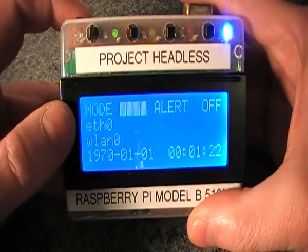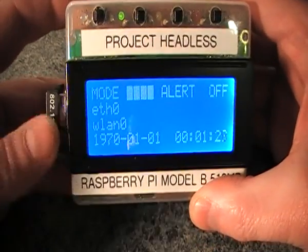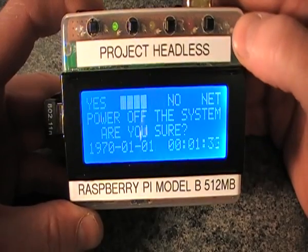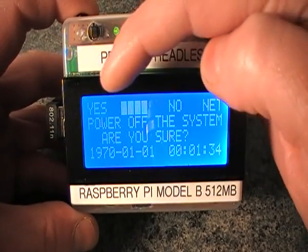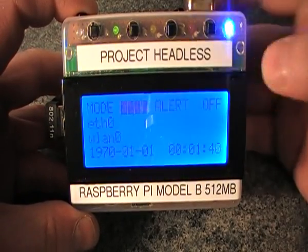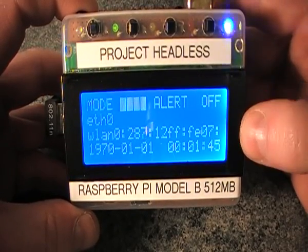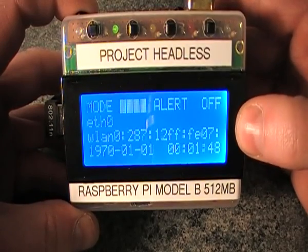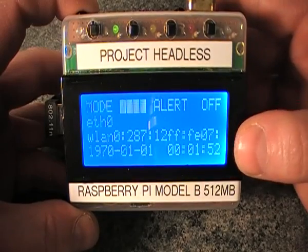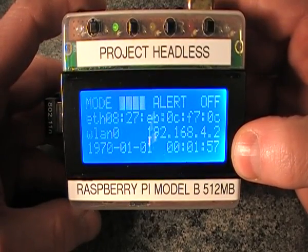At the moment you can see I've got a LAN cable which is not connected, and I've also got a Wi-Fi adapter in it. If I go into the off menu — which would normally be used to shut down — there's an option to connect to the net. I press connect to the net and it will automatically try and connect on both Wi-Fi and LAN. It will show an IP address as soon as it's connected, and after a little while you'll see the date and time go from 1970 to the current date and time using the NTP server.